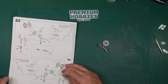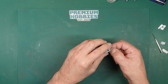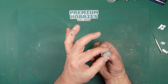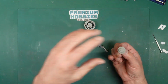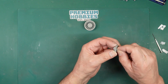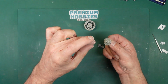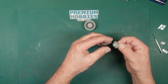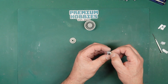And also on the rear, the disc brake, I'll show you in a minute, has a spigot diameter in it, so that with the front, it just goes through, and then the wheel screws up and pulls everything together. On the rear, it's got a diameter in there that this goes up against, so that when you actually pull the wheel on, you're pulling the disc onto this part. So it's not actually just pulling it all through. So basically on the front here, this goes through like that.